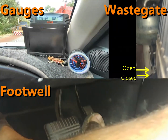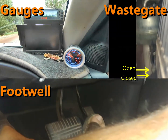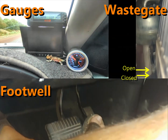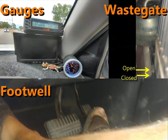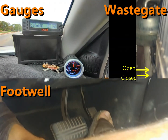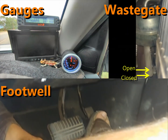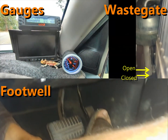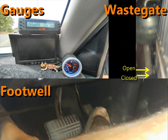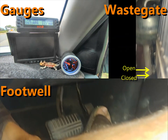You would have noticed that I hit about 20 psi under heavy acceleration, and that this wound back as engine RPM increased. But if the wastegate had closed earlier, I dare say that the boost could have been maintained, which could be really useful if you're trying to overtake someone on the highway. If you're considering an ECU remap for your Pajero, you should be pretty excited now, because this very conservative wastegate behaviour means that an ECU remap would have great potential to improve performance simply by modifying the wastegate behaviour.